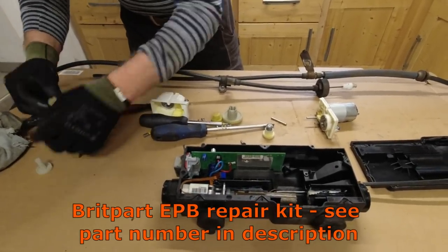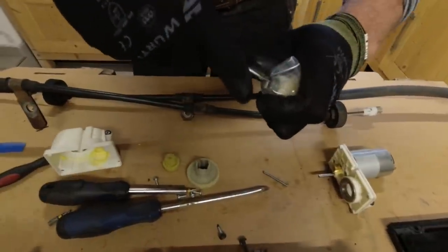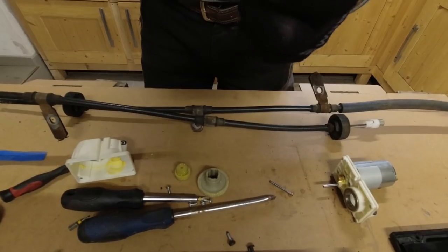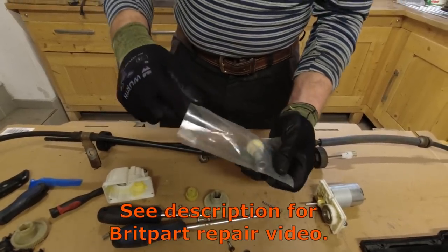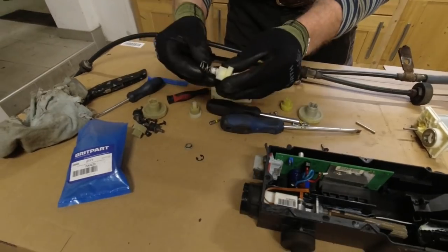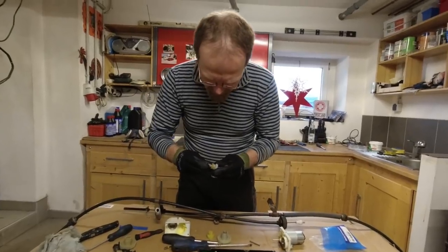There are the new parts. I put the one-way clutch in a plastic bag and then take this piece off — this way the pieces aren't flying away. This was in the Britpart video. The clutch spring — and we grease this up. Now we've got to put this back together.